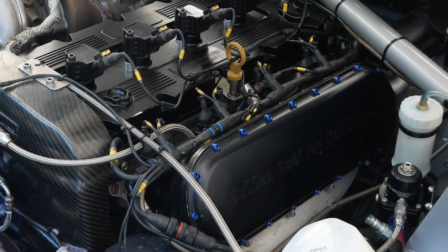The inlet manifold is fitted with a pair of injectors per cylinder. This is nothing new for the YB Cosworth — even back in Sierra Cosworth RS500 days, it came from the showroom floor with two injectors per runner, though the second was disabled in stock form as an easy aftermarket upgrade. In this application, it's all controlled seamlessly through the Cosworth ECU in a staged fashion: one injector per cylinder at idle and low RPM, with the second staged in as boost and RPM increase to match fuel flow requirements.